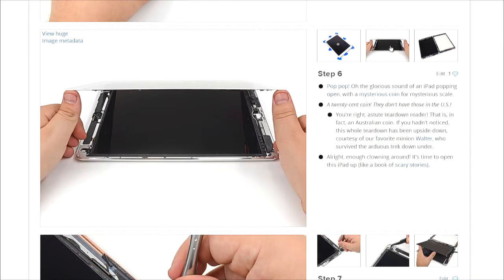It stays soft. You know, I already went around the perimeter with the eye opener, and I already loosened it partially. But the problem is, there's actually a cable right here that we've found out through trial and error. Yeah, exactly. So I have to be very careful to just slightly bend the panel around the perimeter so that it slowly comes up without actually shattering. And then it'll just lift over, and that'll be that.